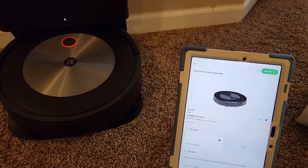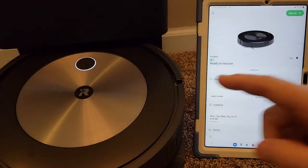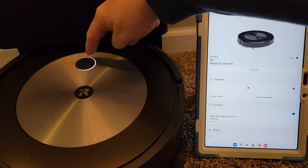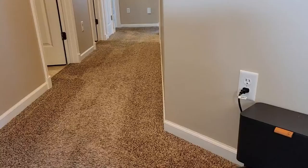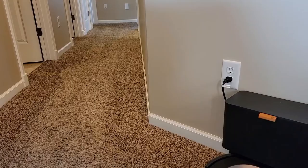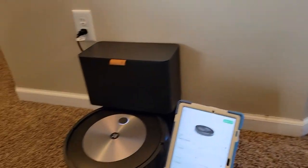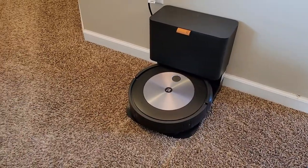I'm going to let it charge. I'm going to make sure the floor is clean — open up the doors, pick things up off the floor. It's probably going to have to map your house. So my Roomba's got enough charge. You're going to simply hit the clean button — press that one time and it'll start cleaning — or you can tell it to clean everywhere. It's going to have to vacuum your house twice in order to get a map. Some pointers: pick things up that normally aren't on the ground, and also turn your lights on — that's going to help with the initial mapping. You don't have to have your lights on every time it runs, but it does help with the first initial mapping.